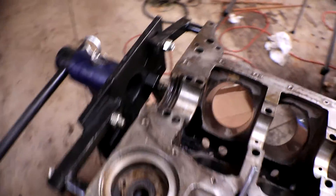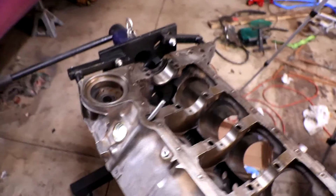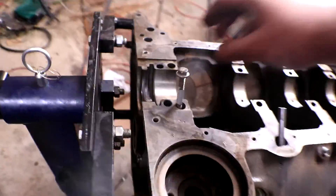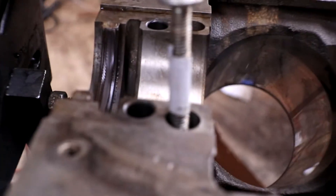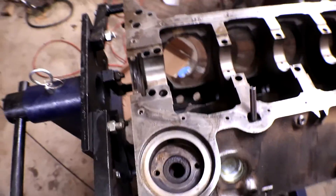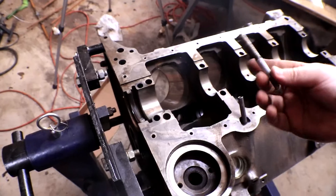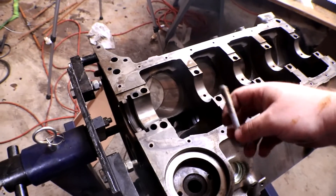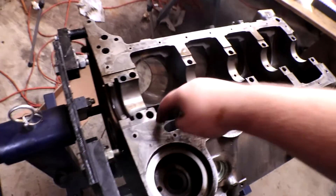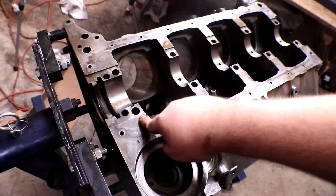After some finagling I realized I had to go buy myself a new freeze plug for this port. With the screw down in here we're just right before an inch and three-eighths, and I can clearly see the hole where the oil comes through. If you go up the other side with a really long pick or a wire bent at a 90-degree angle at the end, you can actually feel the oil passage on the other side as well — so I know both of them are open and it's sealed super well.